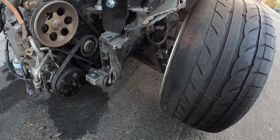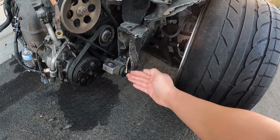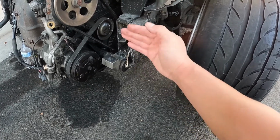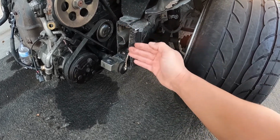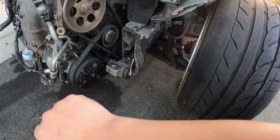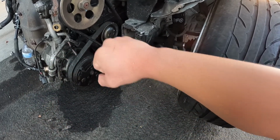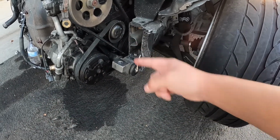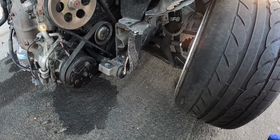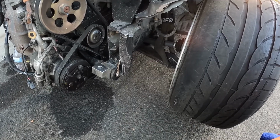And I'm thinking this time it'd be smarter to put a flat plate here, definitely after we cut this nasty weld off and make this flat. Then maybe put a bigger pipe, and on the front end put a smaller pipe that fits just right, and then put a pin or a bolt on both sides, and that will pretty much hold the front end. Like a quick release style front end.